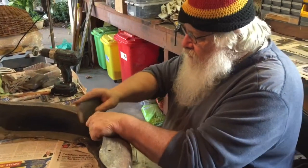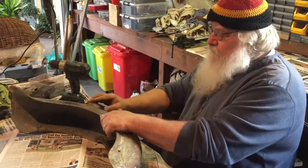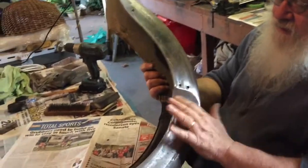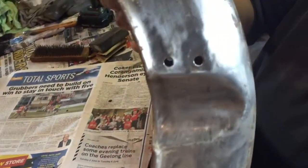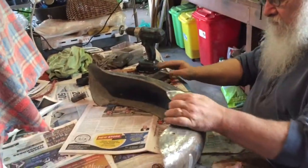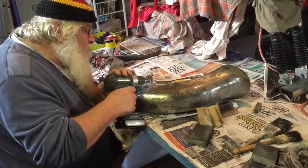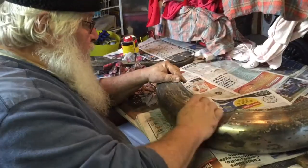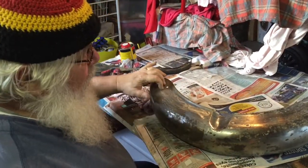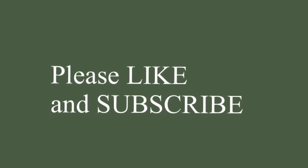The better you do this job, the better the final job. If you take shortcuts here, you'll see it on the final job. You can see it gets nice and shiny — where the paint has gone there's still a little bit of paint there. I won't get all the rust off but I'll neutralize it. You can use very rough sandpaper for that because you need scratches on this panel so the etch primer will stick to it and the paint will stick to it. Whereas later you have a smooth surface so that it looks shiny.